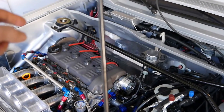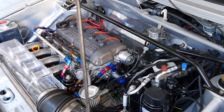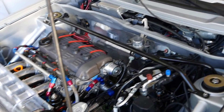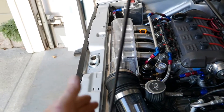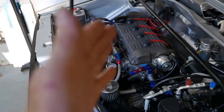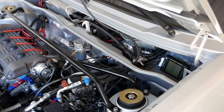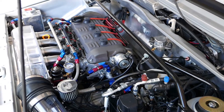The electric water pump controller is sensing the temperature leaving the radiator, which is always cold, but the cylinder head gets quite hot - I can get above 220 to 230 degrees Fahrenheit and start puking out the overflow. I'm going to set the temperature down as far as I can for now, but I'm going to move that sensor from the return line up to the cylinder head. I've got too much radiator - it's cooling the fluid too much. Worst case, I ditch this controller and run everything off the Holley ECU so I don't have this controller with a mind of its own.